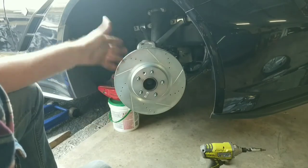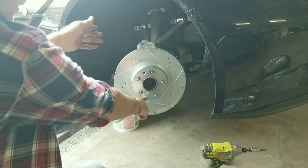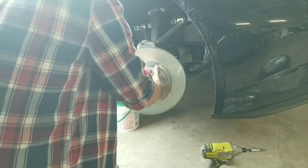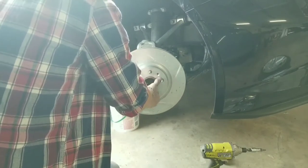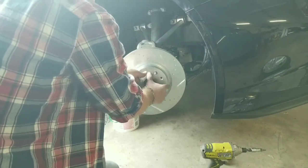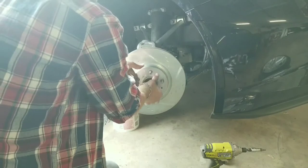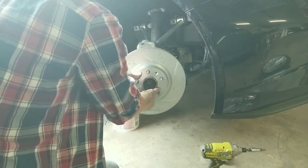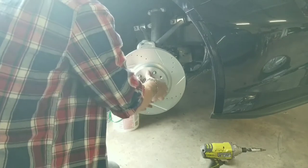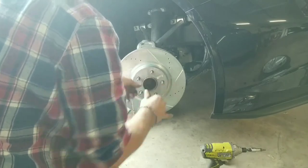How's that look? This says front passenger side. Nailed it. I didn't even notice that it had that on there. We still got a little rubbing noise on our dust shield, but sounds very consistent. So you know what that means? That means it was our rotor, not the hub. Because if it was the hub, that scraping on the dust shield would be inconsistent. Woo!